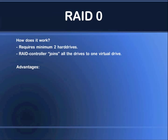The advantage of RAID 0 is that you have increased reading and writing speed. Two hard drives in RAID 0 will perform much better than a single drive. So instead of having one drive of maybe one terabyte, if you have two 500GB drives, you will get one terabyte of storage capacity, but the reading and writing speed will be much higher.